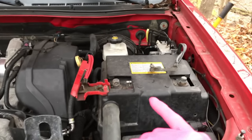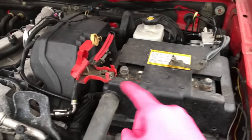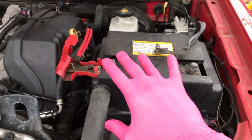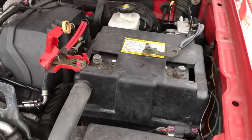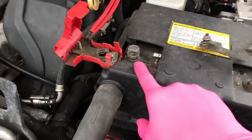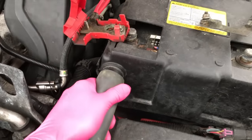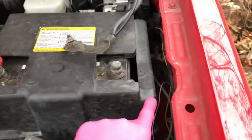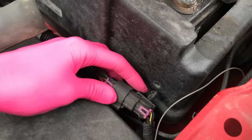At the engine, what we need to do first is remove this battery, cut all electrical power for safety purposes, and gain access to screws down below. Negative terminal, remove that. Positive terminal, remove it from the terminal lead, and you have this rubber hose. Carefully shift this off — on the left side and right side you have clips, and on the front portion you will remove this carefully.